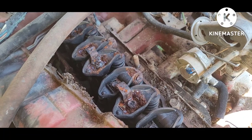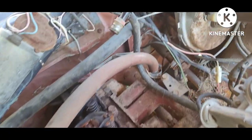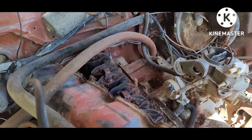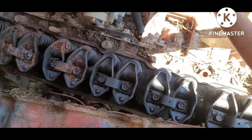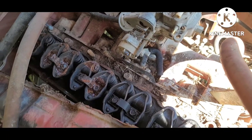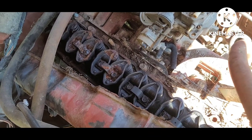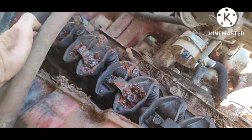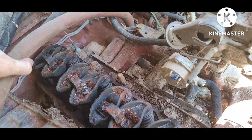And not really sure why, but it's been kind of crusty from water. See the PCV valve, it was in there and sealed, and hood was down, so kind of puzzling how there'd be water to settle on top of those rocker arms. Sometimes if a valve is open, like an intake valve, it'll allow water in, but the stuck ones were this one here and then that one in the back, and they both appear that the valves are closed.